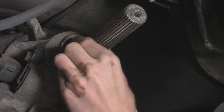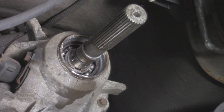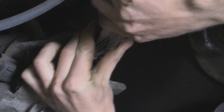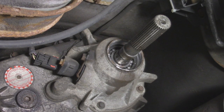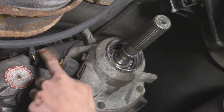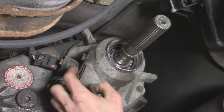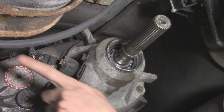These quality pliers work so much better than cheap snap ring pliers. With those two rings out, next we remove the speedo sensor. Pay attention to how it's clocked — the sensor sits flat to the face of the transfer case because these go in certain positions to mesh properly with the speedo gear on the shaft. It's locked in by a little fork. Remove that with a 13mm socket on one nut, then pop out the sensor. First remove the electrical connector by popping out the red safety clip, then squeeze and remove it. The locking fork comes out — hang on to that, we'll reuse it.